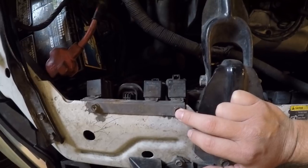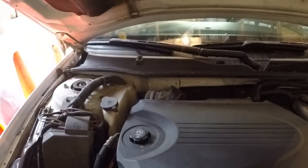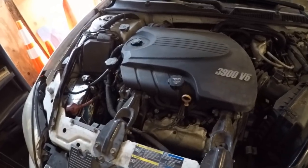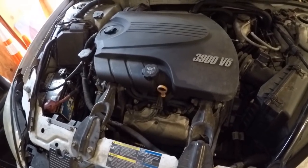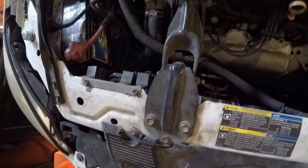The reason I'm not certain is because I don't have the police option code for the built-in headlight flashers. If you have that code, underneath the footwell on the passenger side you'll have basically a green and red wire that, if you power it, will automatically blink the headlights and the taillights. I dug around in there — I don't have that wire or that option code, but I do have these relays. I think this may have something to do with the horn option, and I believe there was some pre-wiring for grill lights too.